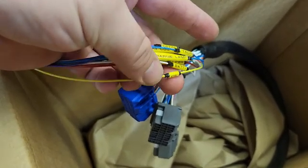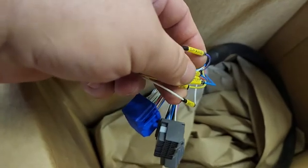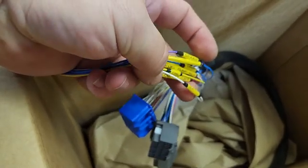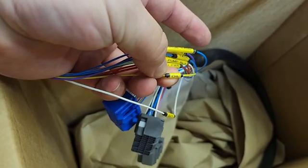There's one for your oil, and there's also a spare purple one in there. The battery plus one has to be hooked directly to the battery because it's for your ECU memory. The oil wire comes up and over and hooks up to your low oil pressure warning switch right over here. You can swap that out for an oil pressure sending unit — you can get one of those little bullet connectors from the auto parts store, a male one that'll stick up in there, and make a little jumper to attach to your oil pressure sending unit.